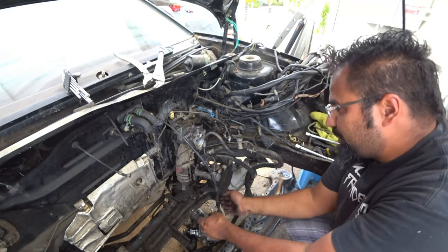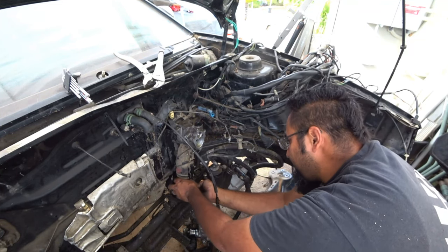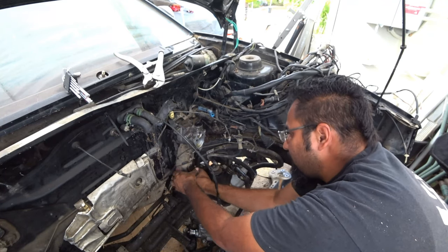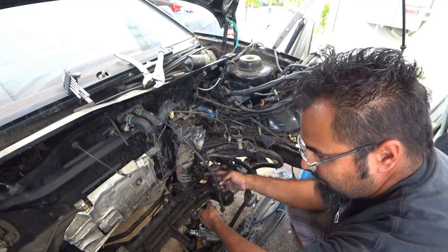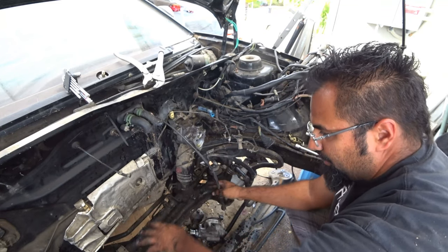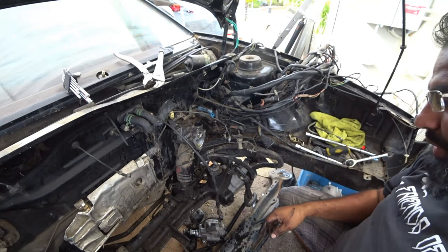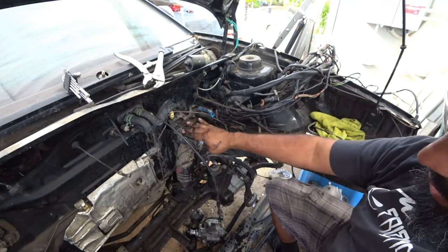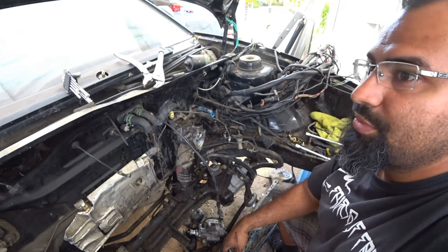The next thing we're going to have to do while we're out here on this side of the car is get the little 10 or 12 millimeter socket inside here so we can take off the locking mechanism that holds the rack in place up here, so we can drop the whole subframe as one piece, and that way I can clean everything up a lot nicer. And then once the wiring comes out and this comes out, we can start shaving the engine bay, which will come out really nice once we're done.